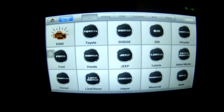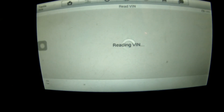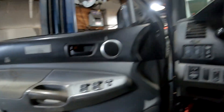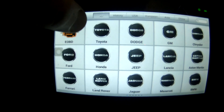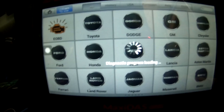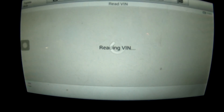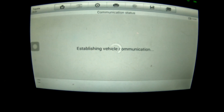Going into diagnostics — Toyota — now I'm gonna do automatic selection, which I was doing with the old computer and it would read it. Hit read and it should tell me the VIN number of the truck this computer came out of. This worked with the original computer I had, so I don't know why it won't do it now. Oh — the key wasn't on. Okay, starting over. Toyota, automatic selection, read. It's taking a long time to read. VIN reading failed. Now we'll do manual selection.